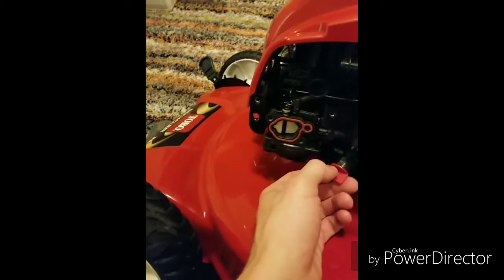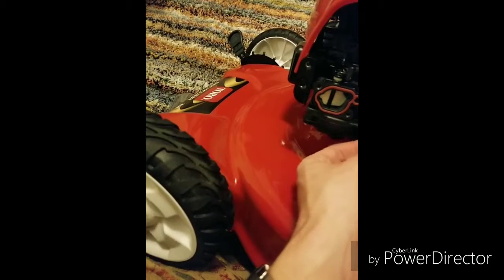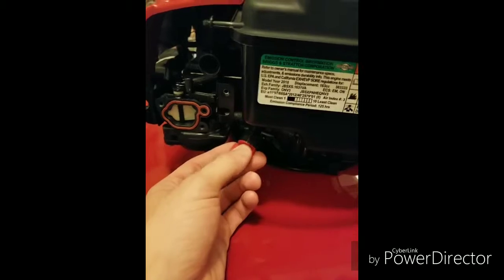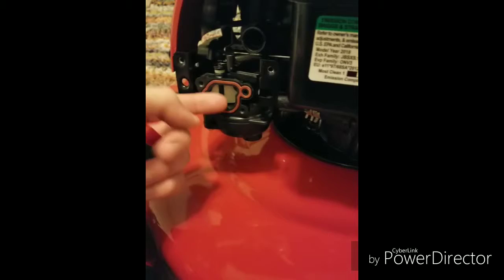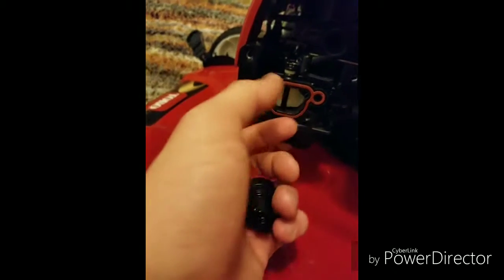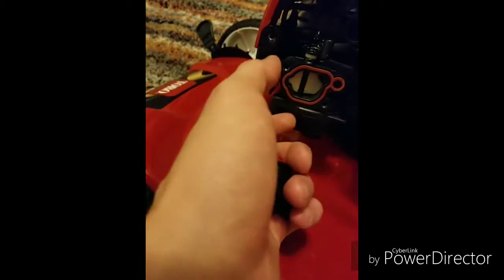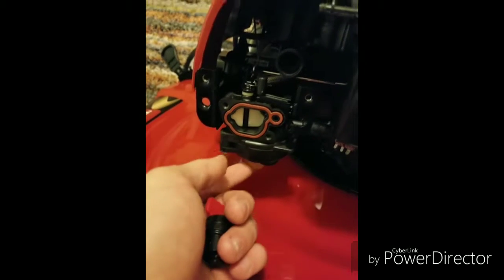What I'm going to do is, when I'm done using the lawn mower, I'm going to keep it running and turn the gas off right here with this valve. It'll continue to run all the gas out of the carburetor without using any from the tank. That helps your carburetor stay clean whenever your lawn mower is not in use during the winter or for prolonged periods of time.